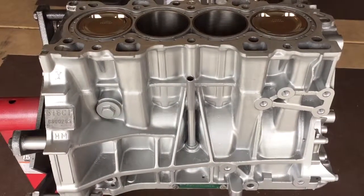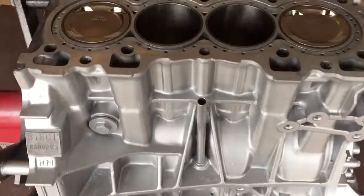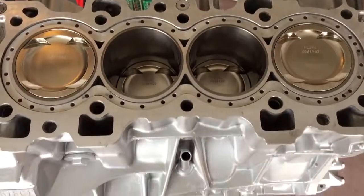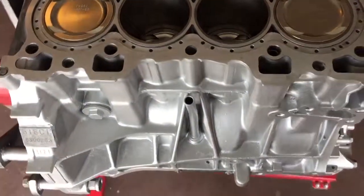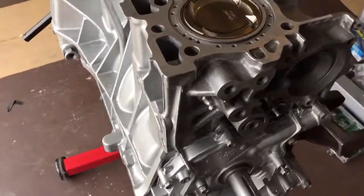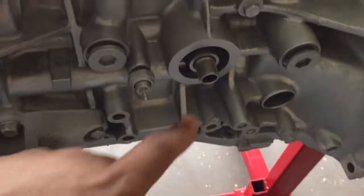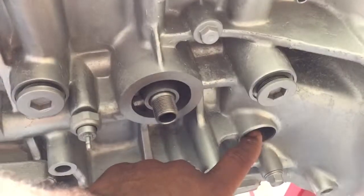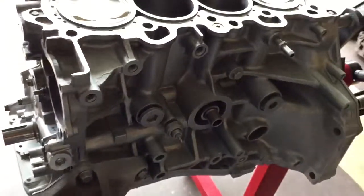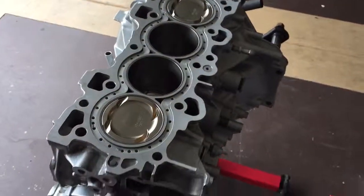It's going to come out to about 8 to 1 compression with the B16 head. Super Tech block guard, OEM water pump and oil pump. We're also taking out the black box and we're gonna use these two ports right here for the catch can and plug this one up. That's where the black box went. Everything came out good on the block — very satisfied.